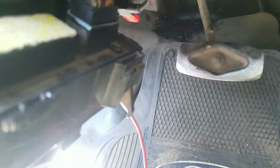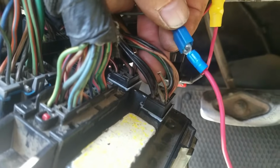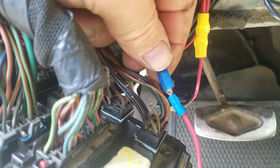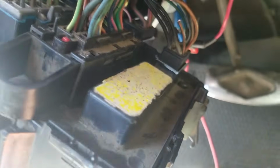I had to sever the wire because it was feeding the other module, and so I wasn't getting enough amps to throw the switch. I also discovered something else. This is where all the switching takes place. Your positive lead needs to go to a full positive hookup.